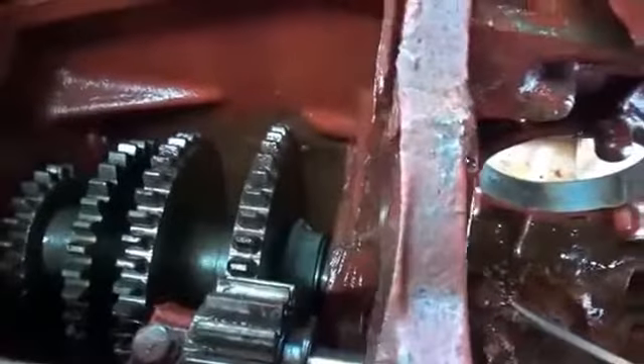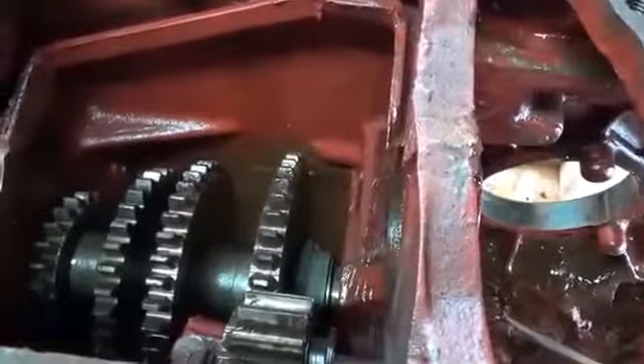It may be the result of that oil-throwing gear that was destroyed. This guy right here supplies oil to the back of the differential. If that thing was busted, not enough oil was getting back there, and that would account for the massive amount of sludge. As soon as I get the final shaft out, I'll take this thing out — I've got a power washer and we'll scrub it up. The decision I've got to make now is whether I want to continue, mow the lawn, or take the dogs for a walk. Not sure. Until next time.